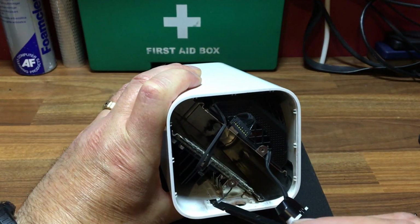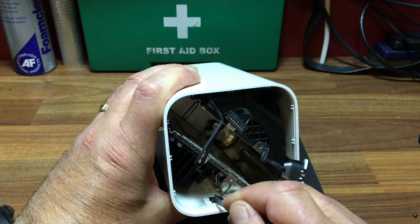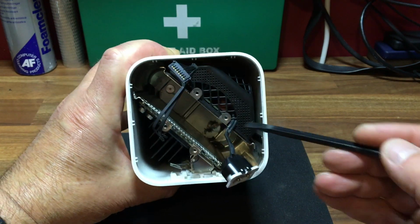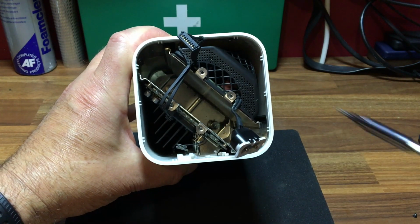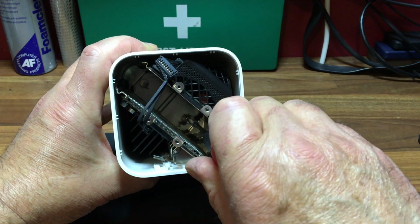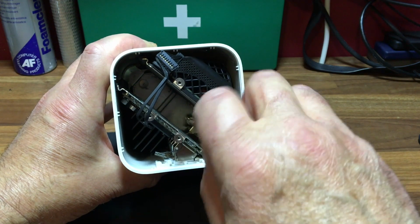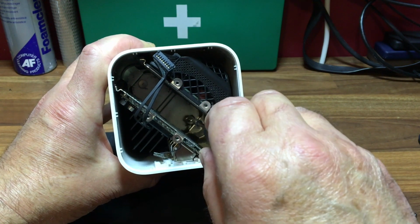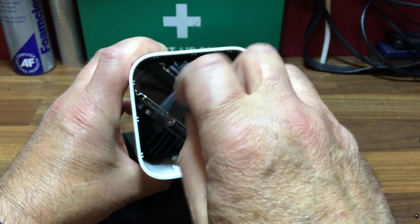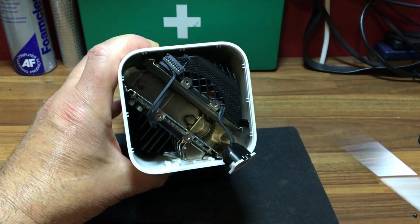Also, down here you have the little reset plate. So just push that down and it should pop out. And I think we're about ready now to work on those screws. So putting the little T8 down there with the extension, screw away. Now they're captive screws, so they won't come out. They'll just come loose. Once you believe you have them loose enough, then we're ready to go to the next stage. Looks like they're loose enough.